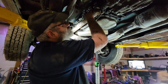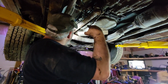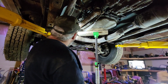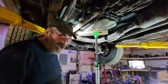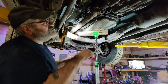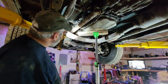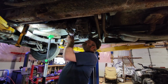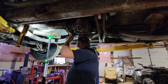Okay, I just got the front drive shaft put back in. Not bolted in yet. You just have to kind of wedge it up beside the transmission, between the exhaust and above the diff. Put the back in, line it up on the splines. That rubber boot is the biggest pain because it's stiff and it wants to grab all the way, so you're messing around with that quite a bit, but nothing special. There's our mount on.